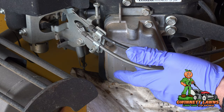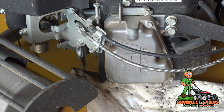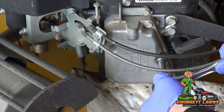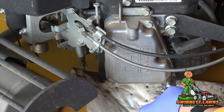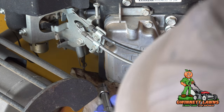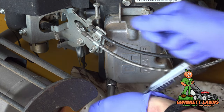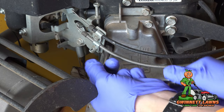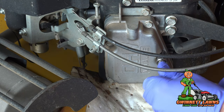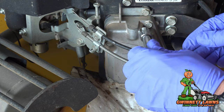You're going to have to remove the rocker arm cover on both sides for each cylinder. This is a V-twin so there are two cylinders. A 10-millimeter socket will take the cover bolts off. Make sure to have something underneath — some paper towels or a small pan — because when the cover comes off there's going to be some oil. I've got a 3-inch extension on the ratchet, which makes this really easy.